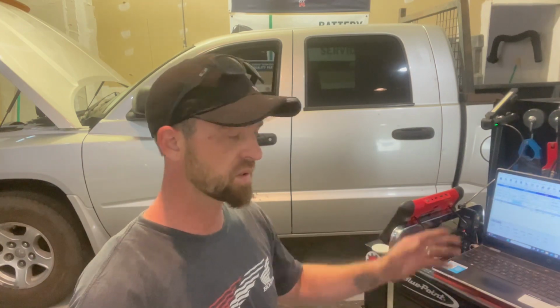But all that's irrelevant. The point is that we tested and we found the issue. If there happens to be another issue with that pressure circuit, then we'll figure that out later. But I can pretty much guarantee you that when I put a compressor in this, it's gonna run. I do guarantee you. And that's precisely why I showed, I got the old compressor laying about in the shop, and I showed you what a good one looks like.